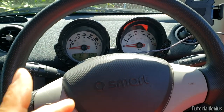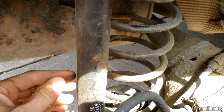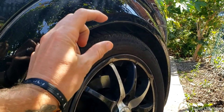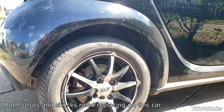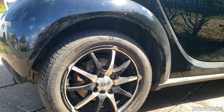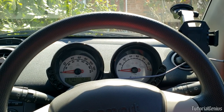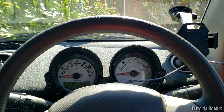The third symptom is a physical check — go under the car and see if the shock absorbers are visibly leaking hydraulic oil. It's quite easy to spot and is a clear sign the shock is on its way out. Another sign is the car bottoming out or having very low clearance. On the front there's only a slight clearance of maybe just over an inch, but the rear clearance is much higher — a good indication one side is lower than it should be, suggesting the struts or shocks are completely worn and sitting down.